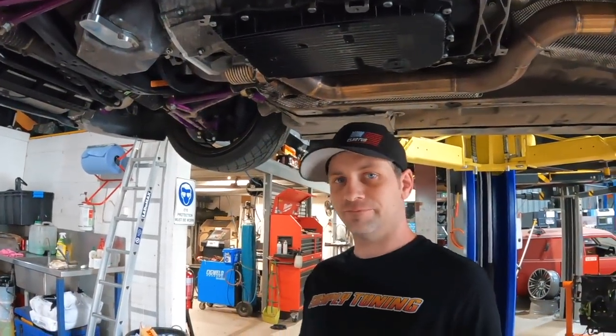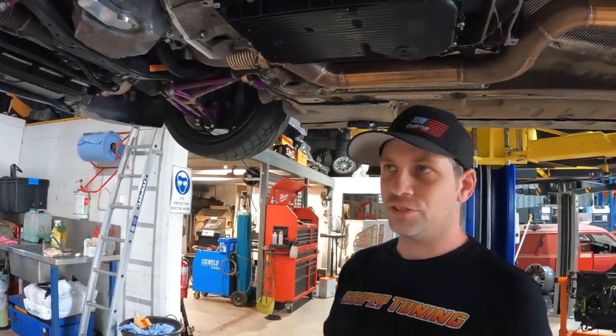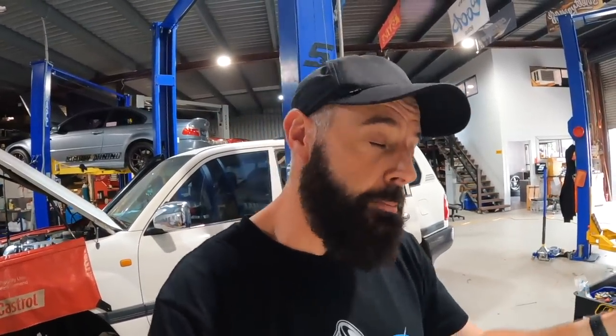Next up is putting a sensor on the clutch pedal to make it feel like a clutch. We're putting the ZF8 — the 8HP70 transmission — into this E46. I've done a couple of these conversions: one HP70 and one HP45, both into N54 cars. These modern 8-speed gearboxes are used by many manufacturers — the Dodge Demon, Dodge Hellcat, Volkswagen, BMW on the new M3s, M5s, X5s. Anything going fast seems to use these transmissions.